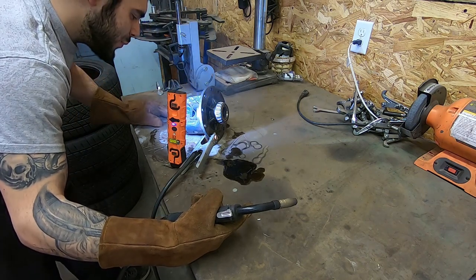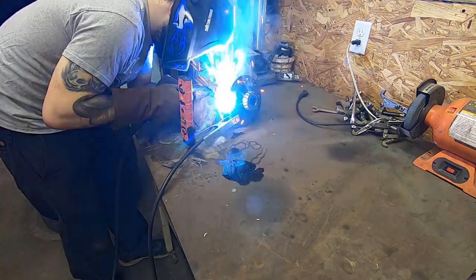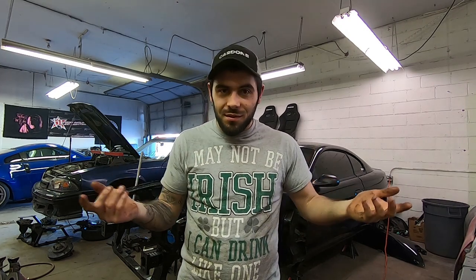I'd like to do a couple more spots here. So it is all welded up — it's really hot though, welded on both sides. Now I just got to wait for it to cool down and then I need to get a crush sleeve for the pinion. Once I do that I can put it back together and it'll be all done. Basically all you're doing is welding the spider gears together and then welding them to the case — that creates one solid object which will spin both wheels at the same time. You've got to weld it really hot. Use gas — I've done it with flux and all it did was break. Use really high voltage, really hot welds and just fill it.